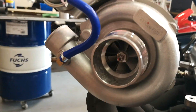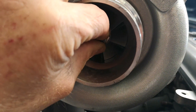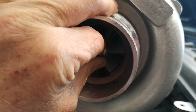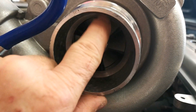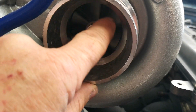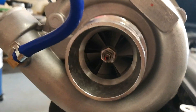We'll take the bungs off and have a look inside. Now this turbo is a journal bearing turbo. There's the tiniest little bit of play up and down, but as far as axially — through the length of it — there's no movement at all, a very small amount of movement. It rotates really, really nicely and feels very clean in its rotation. I don't know a lot about turbos but so far it's looking pretty good to me.